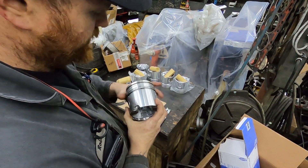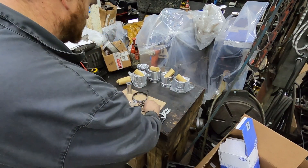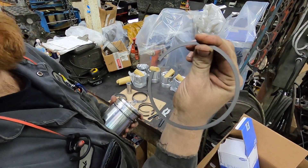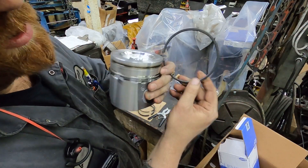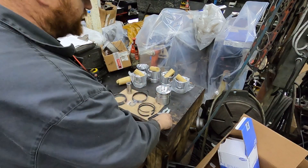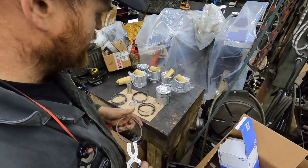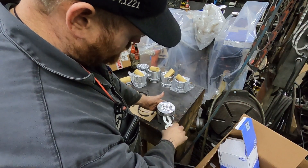It's not usually very hard - sometimes it's because the camera's on, that's what I'm going to go with. On these ones, they're marked with an M right there - you can see the way it's angled down, that groove needs to go down. For those of you who've never used piston ring pliers, these are piston ring pliers - these ones are Snap-on. I'll put a set down in the description if you guys want to see them; they're basically all made by the same company.